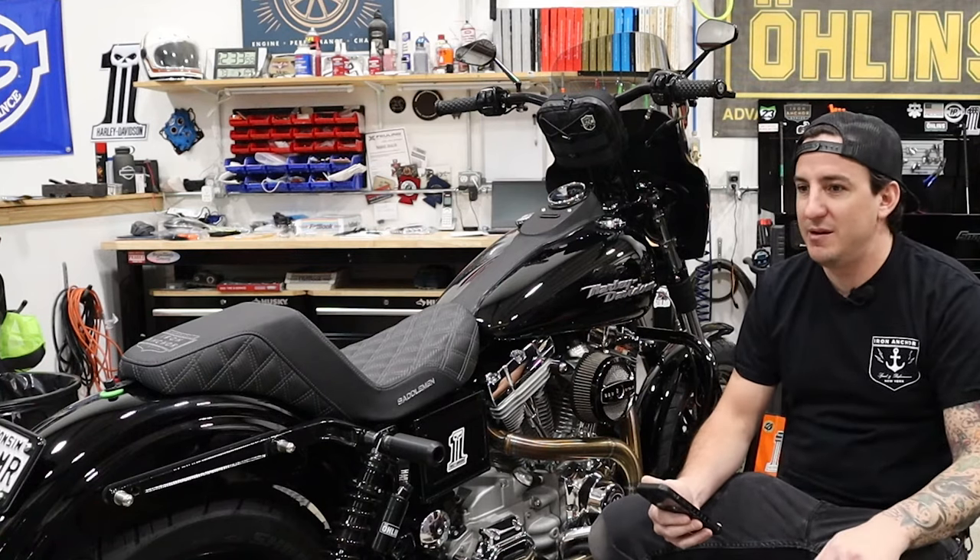Here's a photo of the dyno sheet from when it got tuned. It made 120 horsepower and 113 foot-pounds of torque, which compared to what this was as a stock 88, was obviously mind-blowingly different. Needless to say, incredibly happy with how this bike came out. One of the things you'll notice is it's got a reasonable torque number — it doesn't make a lot of power in the bottom end. The cams in here are S&S 585 cams in a relatively small motor, so really where this thing shines in terms of torque is between 4,000 and 5,000 RPMs. This is not the setup for everybody, but for what I was looking for, it was awesome. The cams come on a little bit later perhaps, but it makes that big horsepower number — 120 horsepower out of this motor is just pretty wild. It was just cool and different and unique.